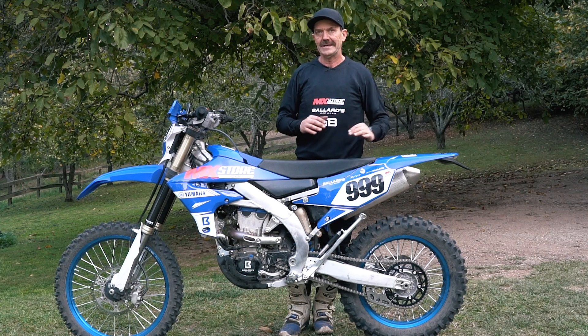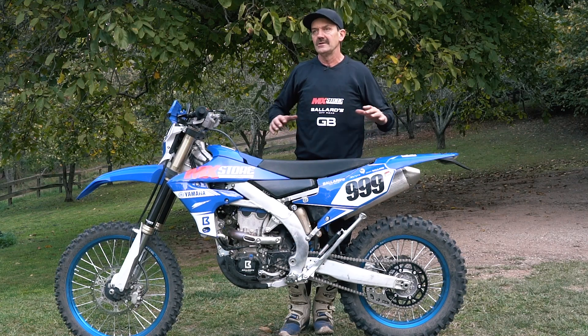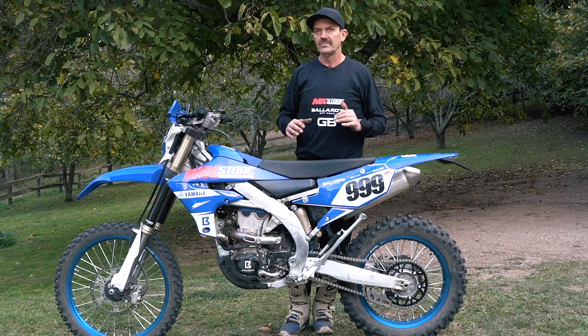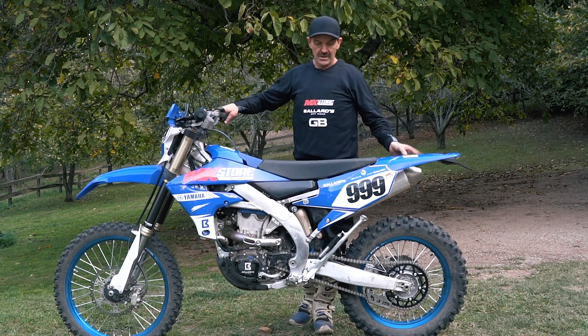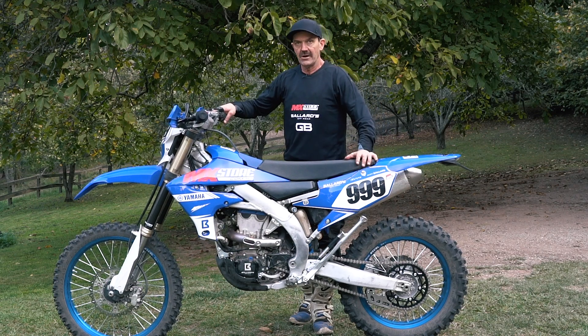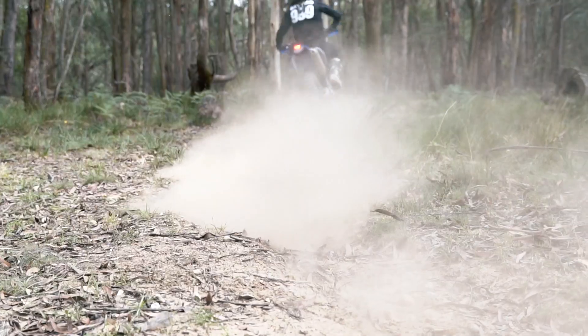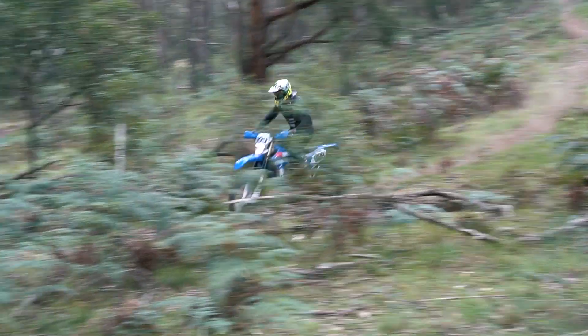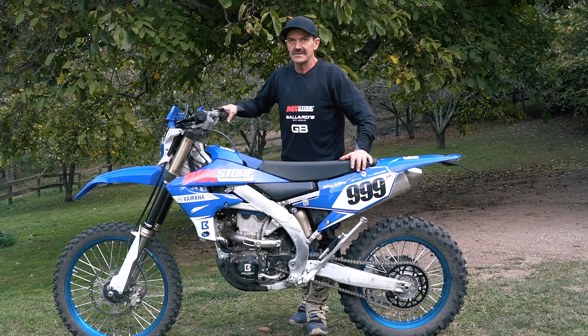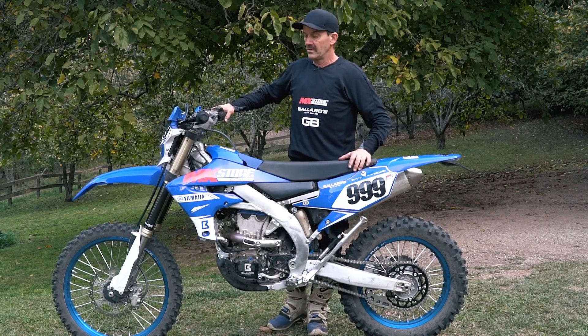So it's really important to get it right. Once you've got the spring right, you don't need to go through all the different formulas again — you just keep checking the bike sag. It'll make riding so much more fun if you get that right, and your confidence will go up because you can tune it so the bike steers better and you'll feel more comfortable on it.